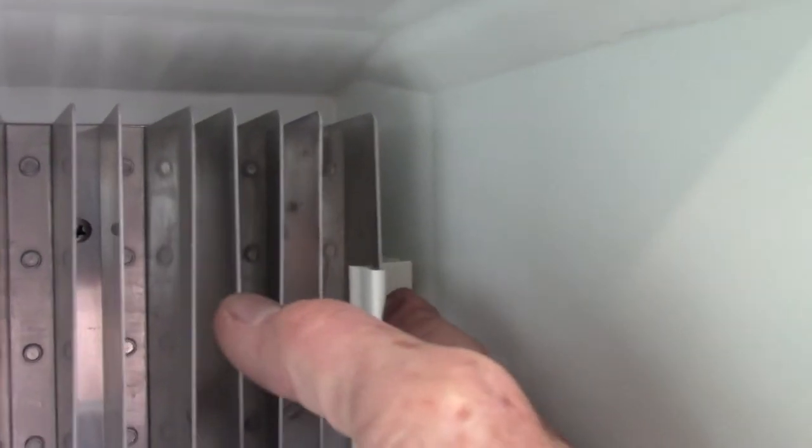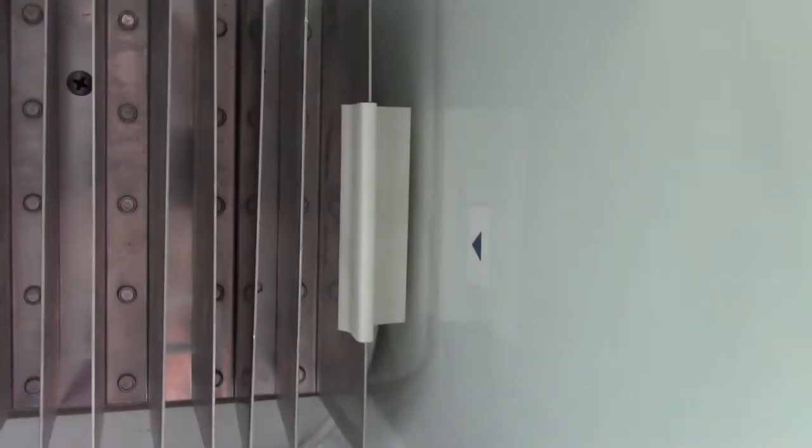This device here is a thermistor — it's on the end of that wire that goes up into this white clip. The thermistor is a cylinder on the end of that wire. The higher you position it, the cooler the refrigerator gets. You want that wire to be taut as it is now, and the refrigerator will be running at full cool. You'll almost always leave it like that — sometimes if it's cold outside and you start to frost up, you can back it down a bit, but generally you'll keep it all the way up.